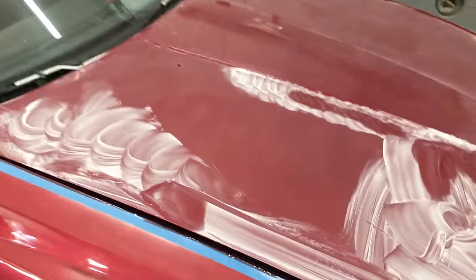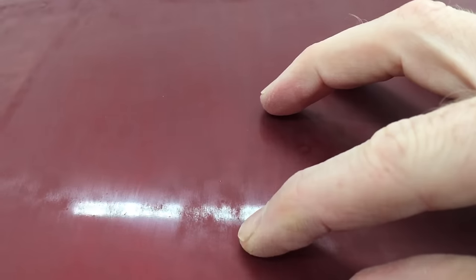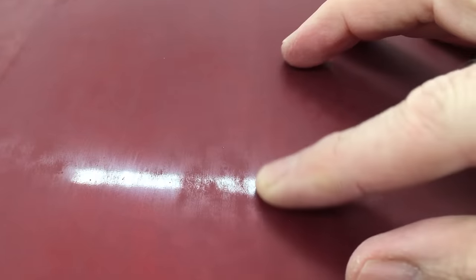I've been working on the hood and also the roof. The orange peel on most of the roof wasn't too bad — there was some dirt in the roof that created some high points. There's actually one that got knocked down with the 1200 grit right there, you can see it's dull now. There were a lot of high points. Unfortunately that bug is forever a part of the Legend's clear coat — it was too far down to wet sand out. I got the doors too with the 1200 grit.